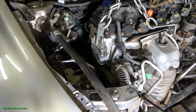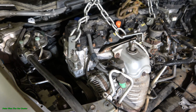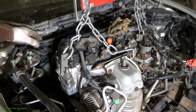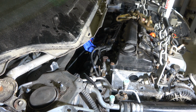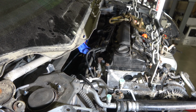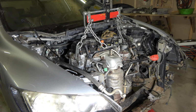And the engine starts to lift up in this way. Then I have to look at all areas all the time to be sure there are no cables still left in the front area and also in the back area. Let's look at the back area. In here I have to check that there is no connection between the car body and the engine area. This is really critical, and this lifting process is best done really slowly. Okay, everything looks good, and I continue my lifting.